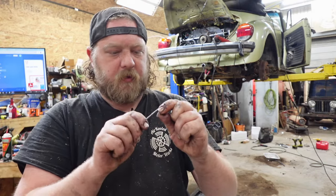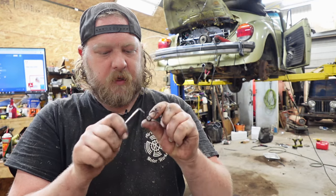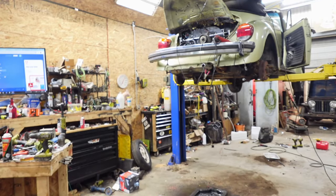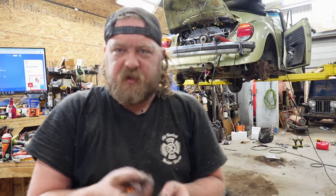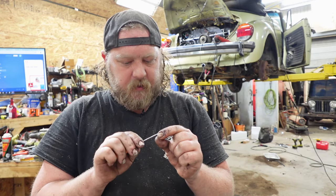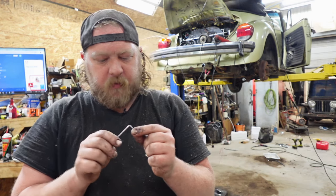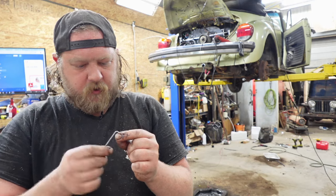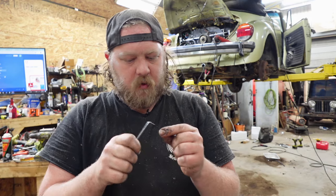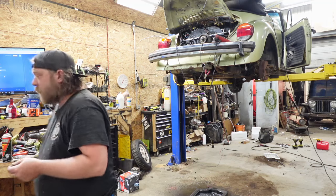This is how you end up damaging the screws, the threads, everything, because now you've got so much resistance on it. Clogging the threads means everything doesn't move as designed. So yeah, no RTV. Not to mention, if the RTV slushes over, it's going to go into your pump, or at least clog your screen. Depending, I've seen some make it all the way past the screen into the pump. So, yeah.